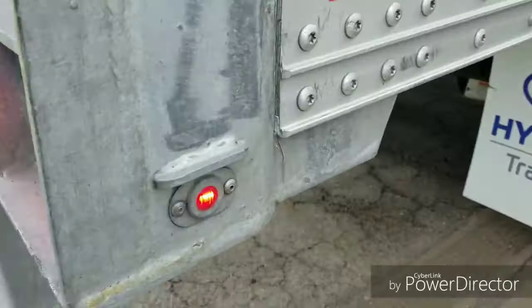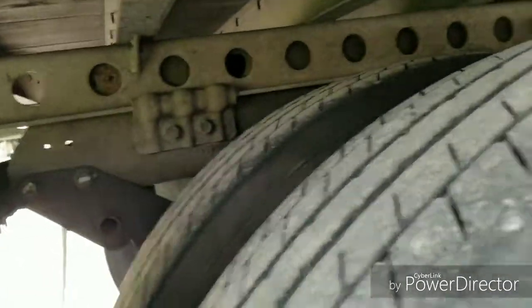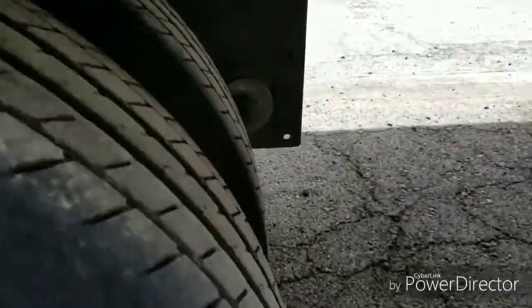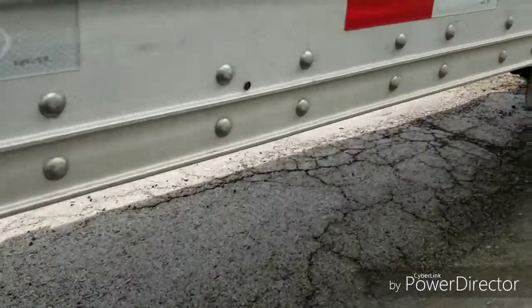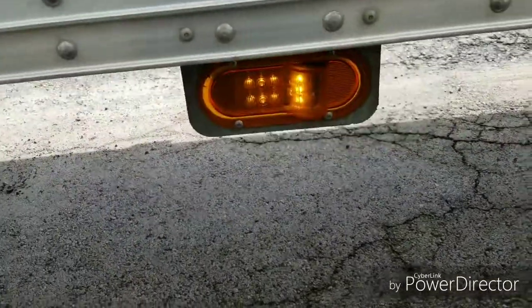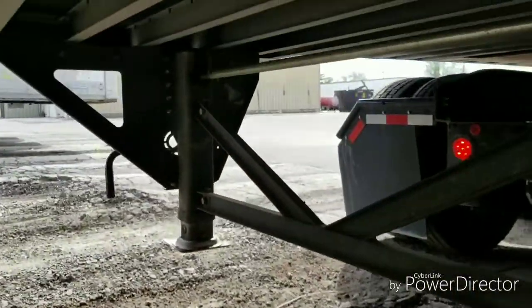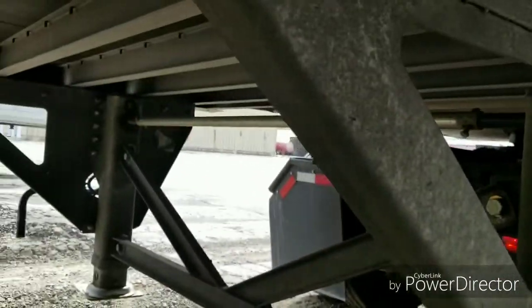We're going to keep walking around. You can check all your lights, make sure they're lit. 2/32 on the tread depth. You want to check both sides, make sure that they're locked in. You can see my pins are both sticking out and they're locked in, and I've got a good tread on this trailer. You want to look down both sides, check both rails top and bottom, make sure there's no damage. Make sure all the yellow and white reflective tape is there. Check the landing gear on both sides, make sure it's intact, no dents or dings, and nothing that's going to make this trailer drop to the ground when you go to drop it. Then check your ribs.